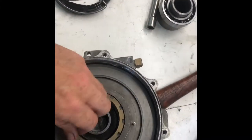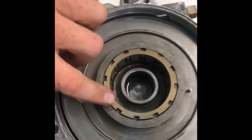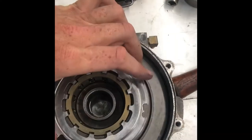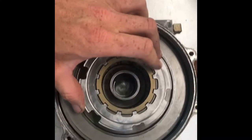We had a SuperATV cage we put in there. We took the rollers and springs out of that one and put them in this one. The difference is it has more holes — more teeth holes — a 12-tooth. Therefore, you can use a 12-tooth plate. This is a Sandcraft plate. More teeth equals more surface area, making it less likely to have a problem.